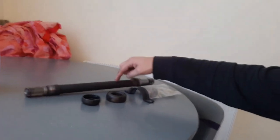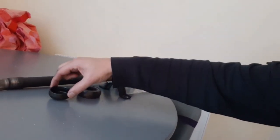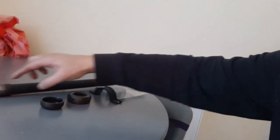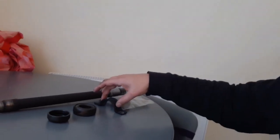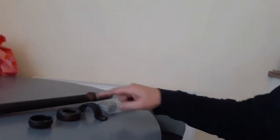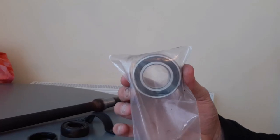Today we're going to be talking about the intermediate drive shaft bearing on a MK3 Mondeo. So I have actually removed it. I'll show you here quickly what it is. We have the drive shaft coming out of the gearbox, the old bearing, and there's a little cup which sits on the end of the drive shaft to house the main drive shaft that sits in the hub, and also you have the bearing carrier there. I bought a new bearing, £20, a bit cheaper than buying the full drive shaft for £80.